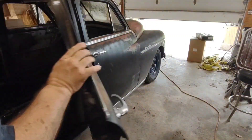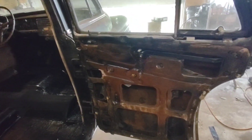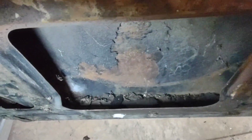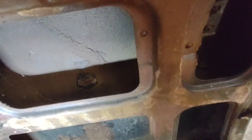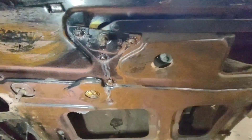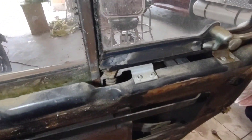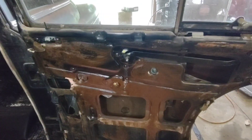Now I'm going to get in here and see what we've got. There's our window crank mechanism. I don't have too much dirt down inside this one. There was some sound deadening material on the door panel that's coming off — we'll clean that off the best we can and use that foam rubber stuff I put on the ceiling. Now we can get in here and lube all the points for the door handle, the window crank mechanism, and the wing window piece down in there. That's pretty much how you remove the door panels from these old Plymouths.